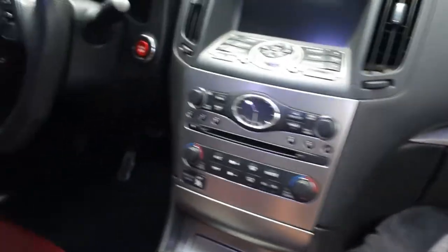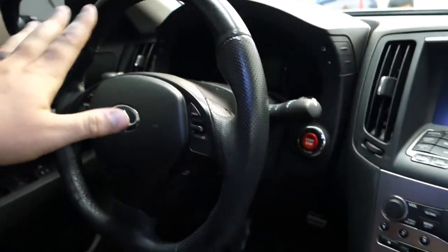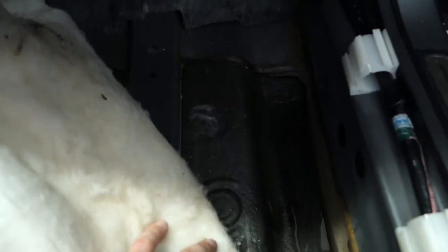That's not a good thing because right up there is your BCM. Initially when this starts, take care of this and get it fixed up, because if that gets wet it can fail and cause you some major problems. One time I was driving and my whole dash just went blank. The car didn't shut off, but everything went blank. Had to stop, turn it off, restart it. That's what this causes. The leak is not a big deal in and of itself, but it can get things wet and cause more problems.